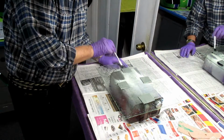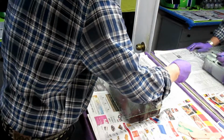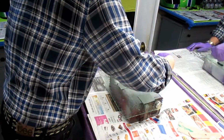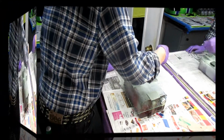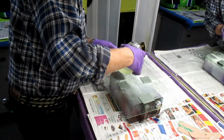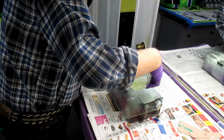But the first thing is, before I lay that carbon cloth, the cloth that has the grain going in the direction I want to see, because this is the only one of the cloths where I'm going to see the grain. So this is really easy peasy to figure out. Times what I've done, and it's been a mistake, is I've tried to skimp on the resin I put on. Let me put a little more on here in fact.